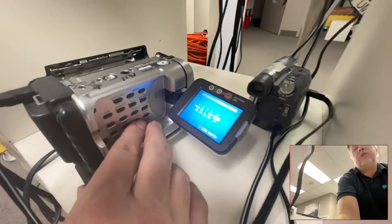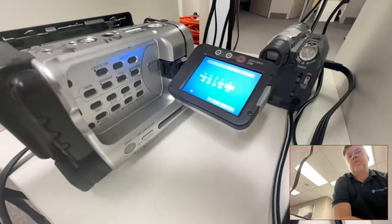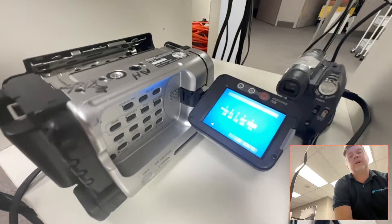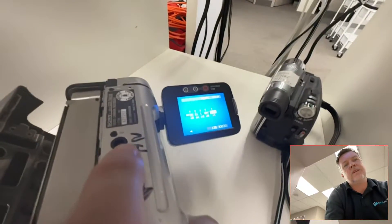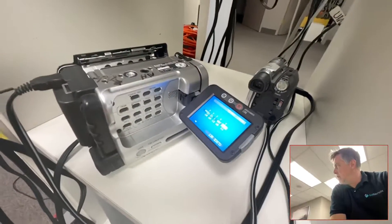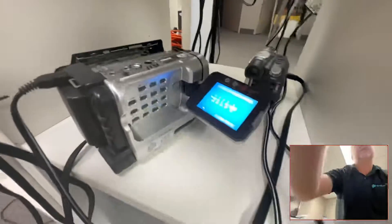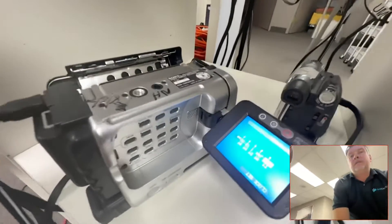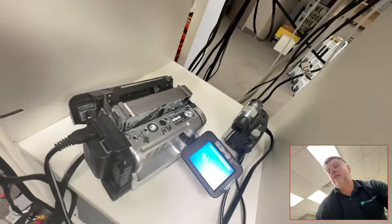So I've got a head cleaner here. These are not cheap — Sony branded, sealed, well over 100 bucks for a cleaning tape, and I only get the ones from Japan. You let that run for 10 seconds, sometimes a couple of times. This camera had a new head installed on August 6th of '22. New heads on these, including installation, you're looking at $250 to $300. That doesn't include the loading mechanisms, which are additional. That's the most common thing that goes with these TRV-138s or 128s.